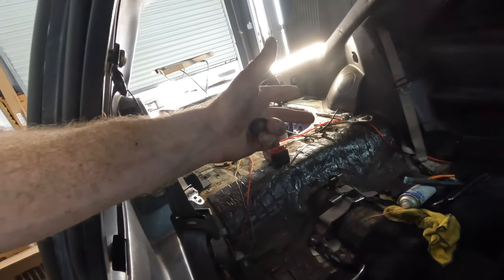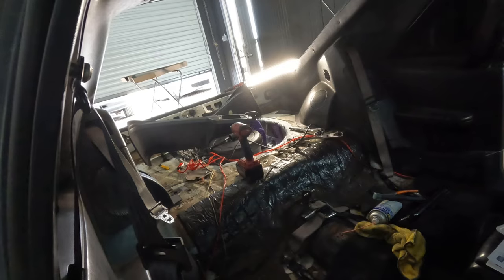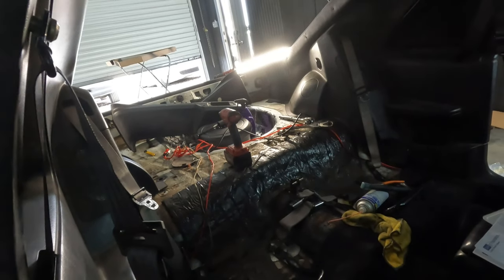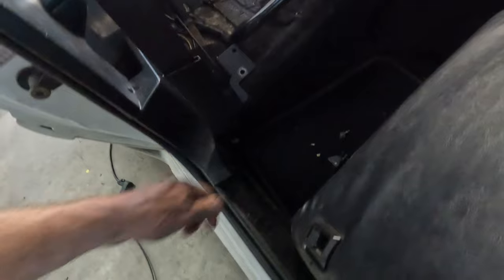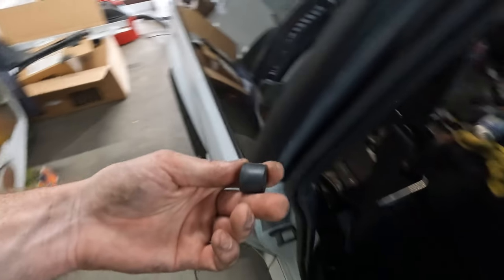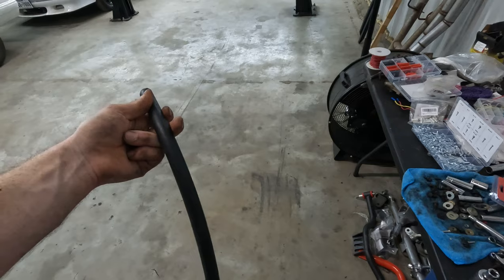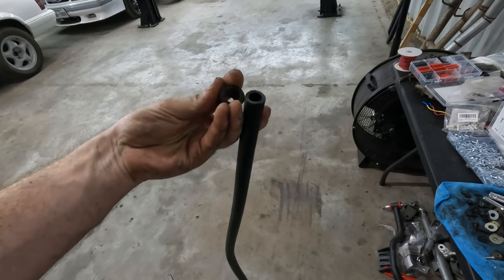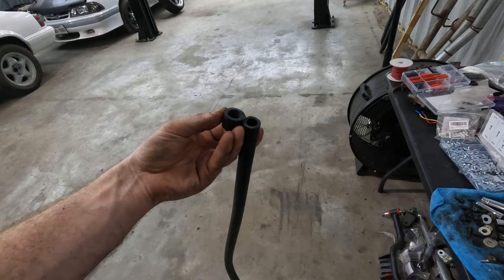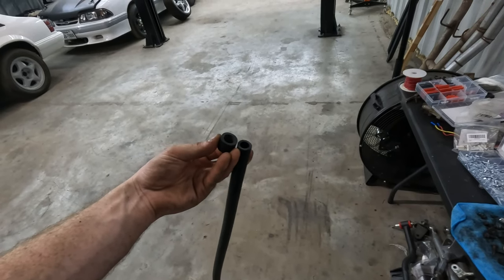Again, it's something that I would do in my own car, not necessarily in someone else's. David's ultimate decision was to go ahead and leave the gray belts in the car. So maybe we'll find out if my theory works later on. Right now I'm just putting this bottom piece in. We got the new plastics with the new belts. Unfortunately they do not come with the little rubber bushings that go down here to keep things from clanking and making a bunch of sound. So here's an easy fix — a piece of heater hose. Just cut yourself a little section off that you need, slide it over the bolt, and it'll be on the cheap. You don't have to worry about putting in an order and waiting for it to come in just to install your seatbelts.